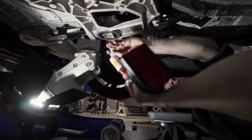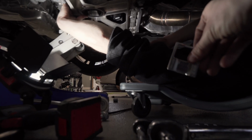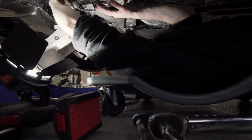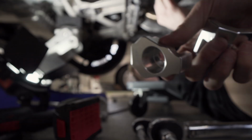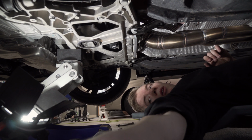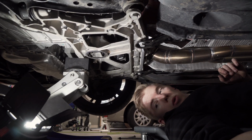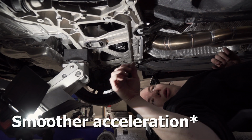Yep. And then you are going to grease the upper Dogbone mount, which is this guy, the other 034 part. And then this slides up in there and reduces play up top. And the lower insert will go in, and we will just retorque that 21 mil to their spec. Then that will reduce movement of the whole front assembly here because you're bracing everything with these 2 mounts. So you should have crisper shifts, harder launches, better acceleration.